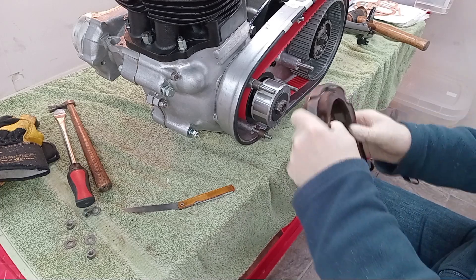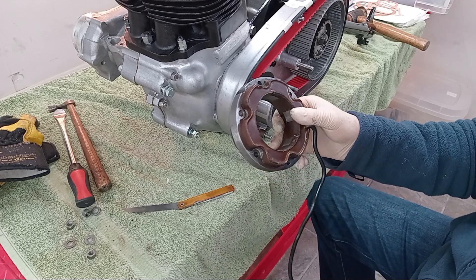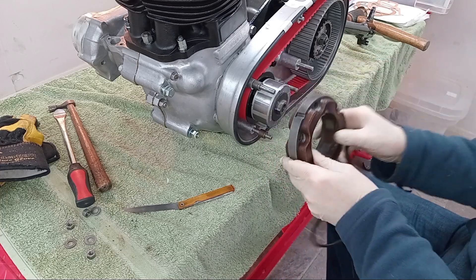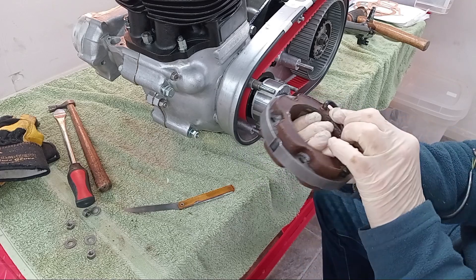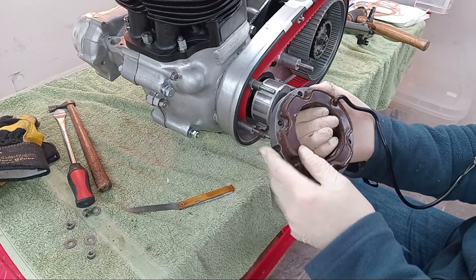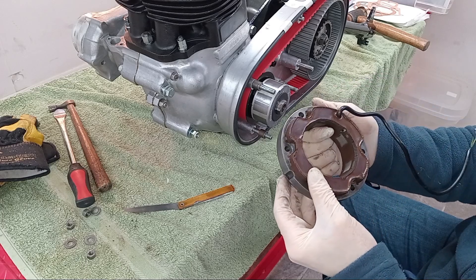So the holes might not line up now. I've got the stator lead coming out at about the five o'clock position on the outside. Always check that the lead isn't broken there — that's where they normally break, in which case get a new stator. This one seems okay; it's a bit old, but it seems okay.